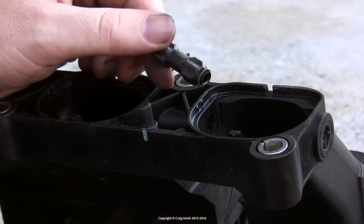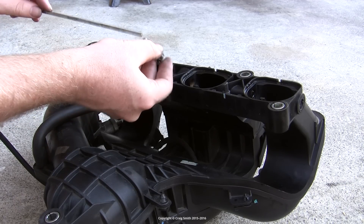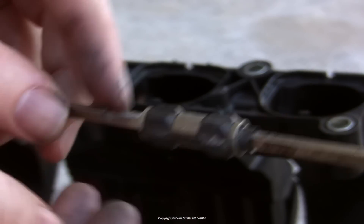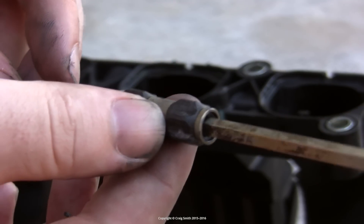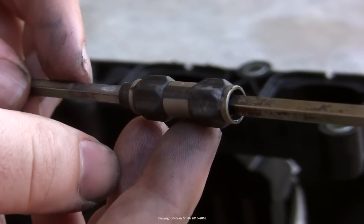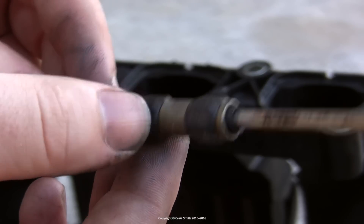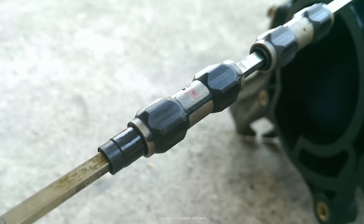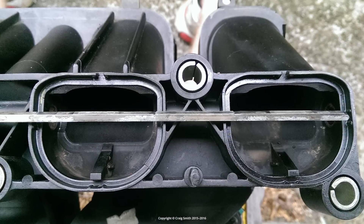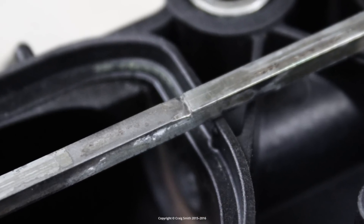You need to push the bushings out and get a closer look at them. These bushings support the rod in its position and allow it to rotate, in turn rotating the flaps. They self-locate with external rubber bits inside the manifold, and are a metal cylinder with a plastic carrier for the rod — probably an oil-impregnated plastic. I think these are the root cause of the failure, because mine are a little bit loose — and again it's the outside one that's a bit worse — and they're only going to get worse with continued use. My conclusion is that the plastic bearing wears too fast, then the rod becomes free to vibrate too much, the flap assemblies are subjected to more wear than designed for, and the rod actually erodes itself against the plastic of the flaps. Eventually, if it continued to its inevitable conclusion, it would all just disintegrate, leading to disaster.